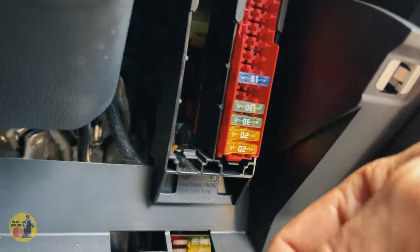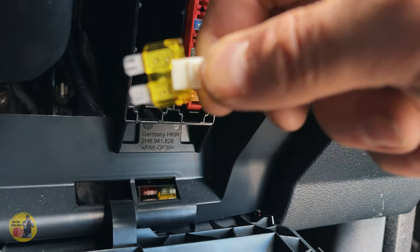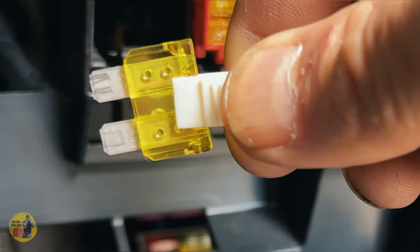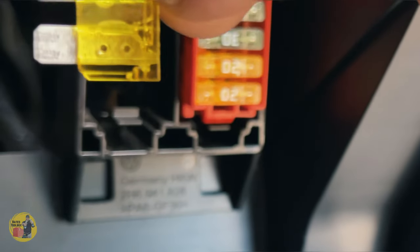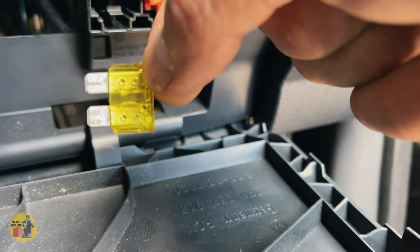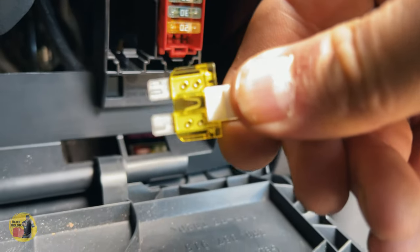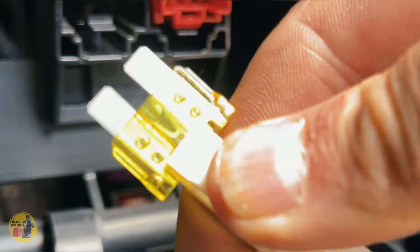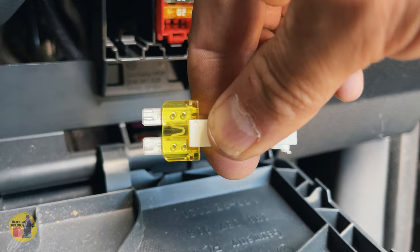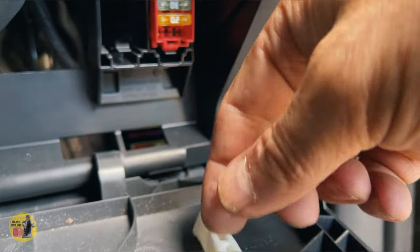Let's just rip out the first fuse and see. That's our first fuse and it looks pretty shot — yeah, that fuse is definitely blown. You can see right through it; there should be a little join in there. Let me pull out a good one to show you what it's supposed to look like — see that little V-shape in there? That's what your fuse is supposed to look like. It's actually easier to replace without the tool.